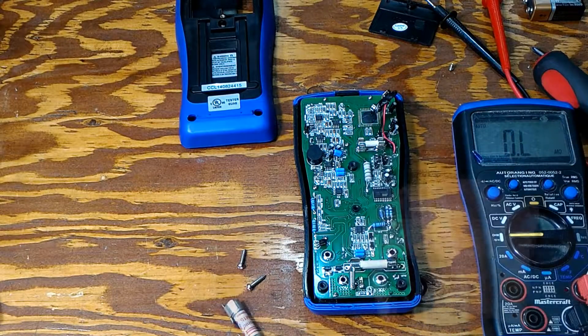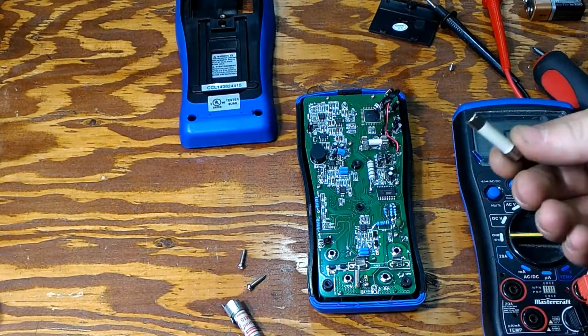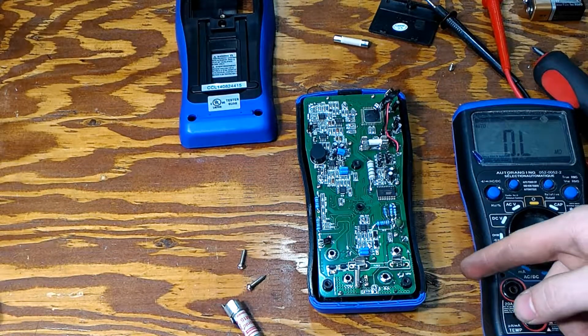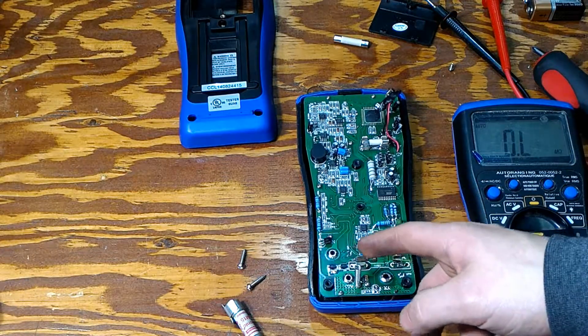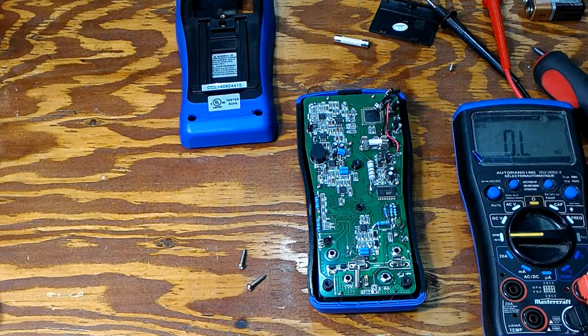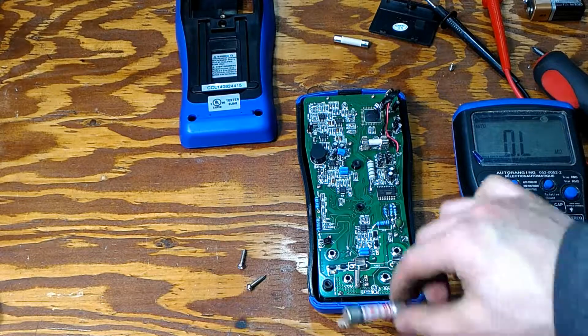The fuse we will put in is a 15-amp fuse. We'll take the old fuse out — it's that easy. If you already have a fuse like this, don't bother changing it since it'll take a lot of time, but since we have time and the right fuse, we'll change it. We'll take out the old holders and place in new holders for the bigger fuse. This 15-amp fuse will allow even 20 amps to pass through for a couple of seconds before it blows, which is excellent for our application.